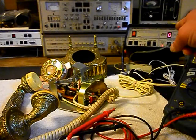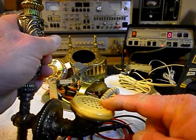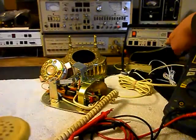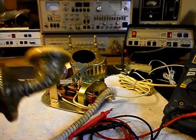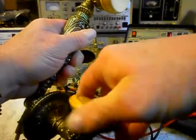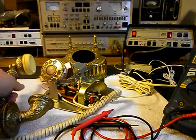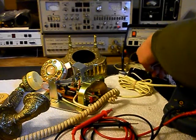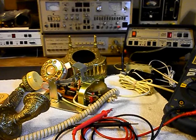Now that we've seized the analyzer and have dial tone, I want to show you one other issue. I'm going to try to transmit into the handset — we're going to tap the hook switch, which will cause the dial tone to go away. I should be getting a red light and I'm going to transmit into the handset, but I'm not getting any red light and I'm not getting any transmit. So we need to take a look at the transmitter — and somebody's removed it. There is no transmitter, so that's another issue we need to take care of. We'll go ahead and unplug the unit and work on the bell circuit and the transmitter.